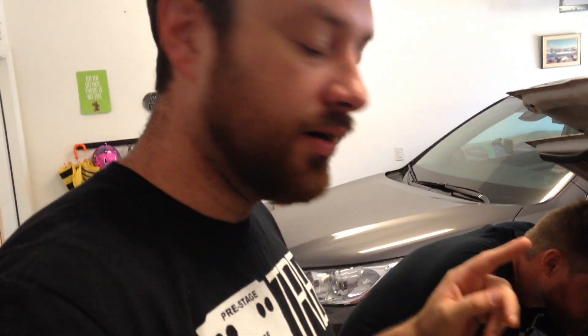If you're tuning into our channel for the first time, just to give a little background on this car — Randall had a 2003 WRX that he traded for this. So when he got the car, we thought it had a blown turbo, which it probably did. So we replaced the turbo on it and then Randall was able to do a compression check, and we found out that on Cylinder 1 he only had 50 pounds of pressure.